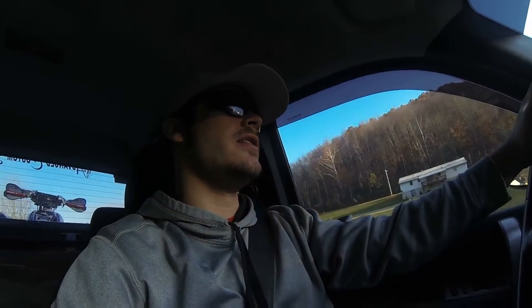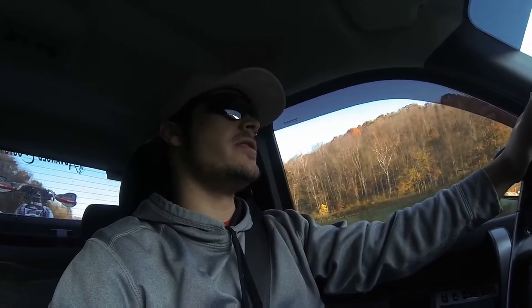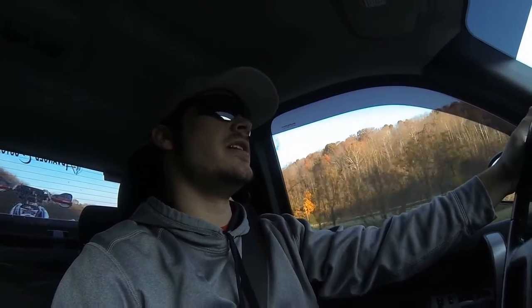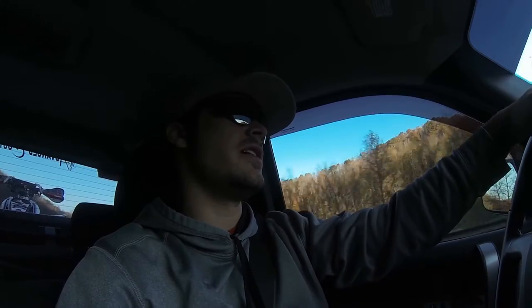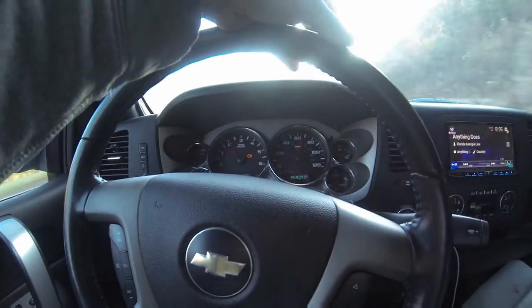I figured I'd make a little video of what it sounds like with the GoPro. Right now I'm running the Pacesetter long tubes, one and three-quarter inch diameter to a three inch collector. I deleted the cats but kept the upstream O2 sensors, so right now it's throwing a code because I took the downstreams out and they aren't plugged in. I'm having them delete that off the board with the tune, and I'm waiting for a computer to show up in the mail.